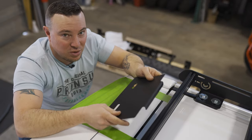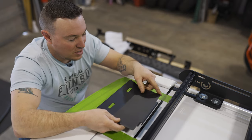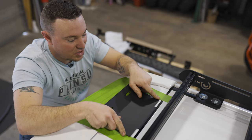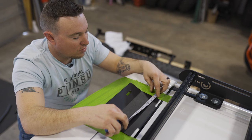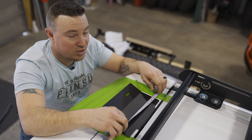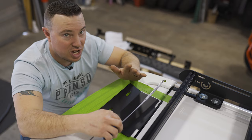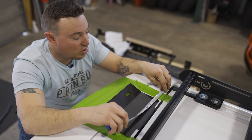So we're at the back of the vehicle. We have our top plate here. What we're going to do is set this in place and kind of understand exactly where our ladder is going to go. We'll set it down here and then measure over four inches — that's where we're putting ours. We did engineer some tolerances; you have about an inch to either side that you can shift it, but for the installation video we're going with four inches.